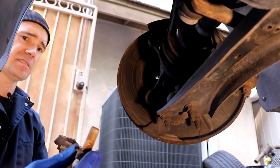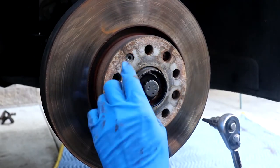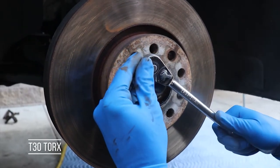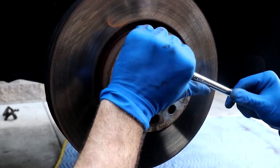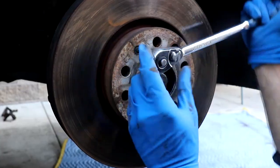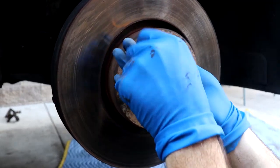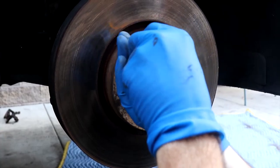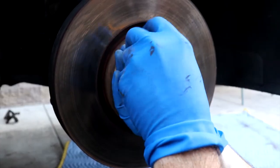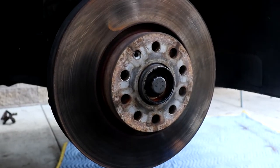It's a little corroded — we'll clean these up with the wire wheel. Next up, to take the rotor off we're going to need a T30 for the rotor hold-down bolt. Thankfully it wasn't corroded. Sometimes you might need to use some penetrating spray, but we'll make sure to put some anti-seize on everything when we put it back together.